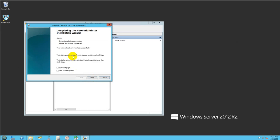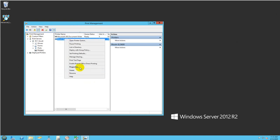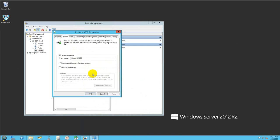The server will now install the printer. You have two options: print a test page or add another printer. I'll just click Finish. The printer is already installed. Looking at the printer properties under Ports, you can see this printer is on port 223 — that's very important.